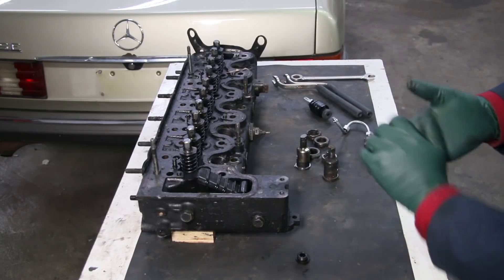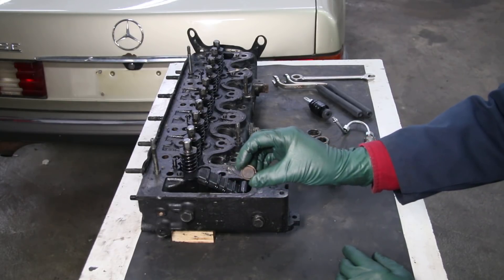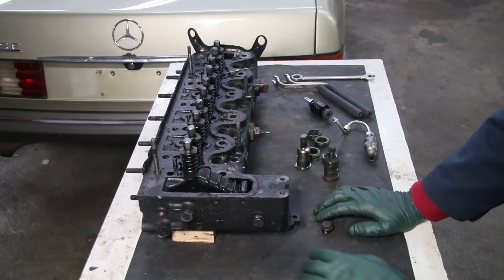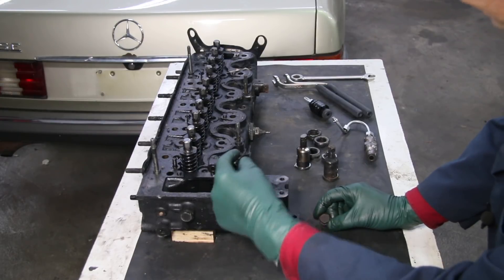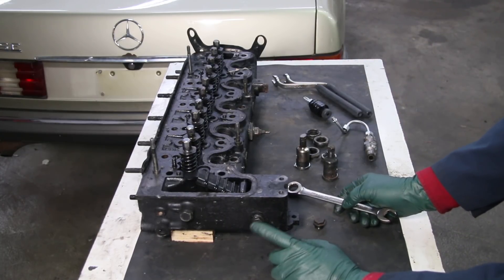The very first alert may be a new one for a lot of you, but it has to do with this little bolt. I've been receiving an increasing number of emails over the years, people saying they've got a hole in the front of their diesel engine and it's leaking engine oil. This is a plug nut that goes right here. There's a pin that goes in here that holds the idler sprocket for the timing chain. These are loosening up and falling out. You need to be aware of this — if you have one of these older diesels, you need to check this.